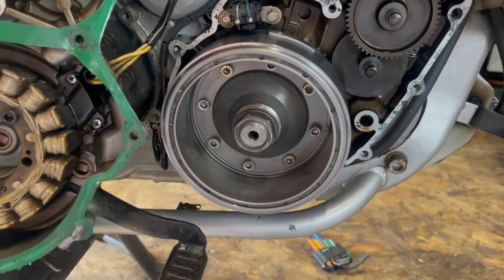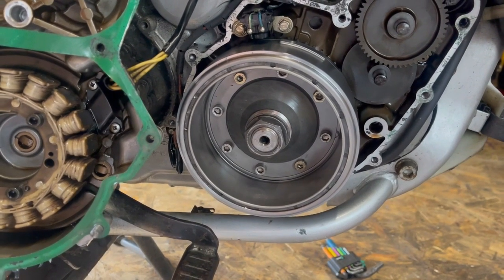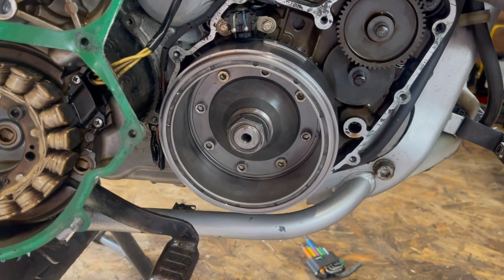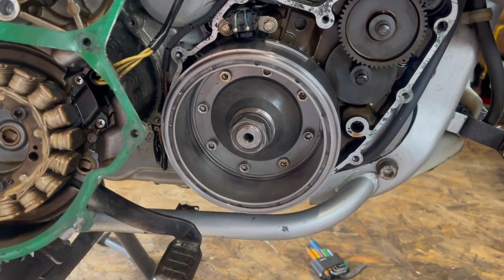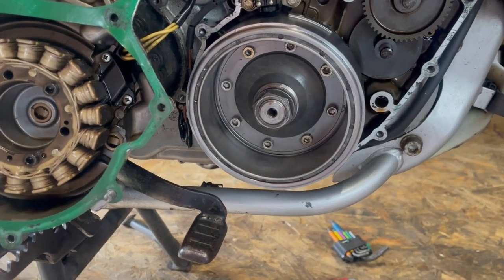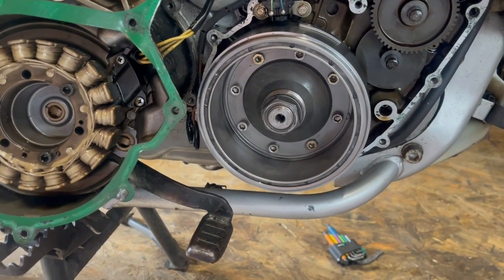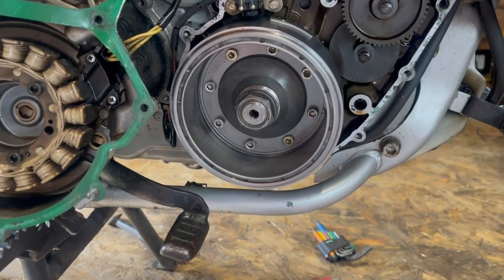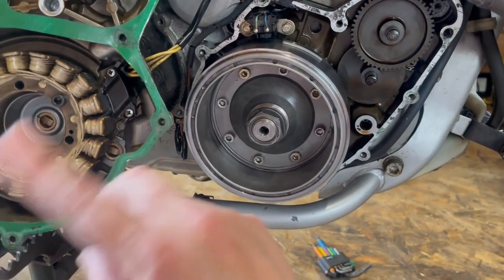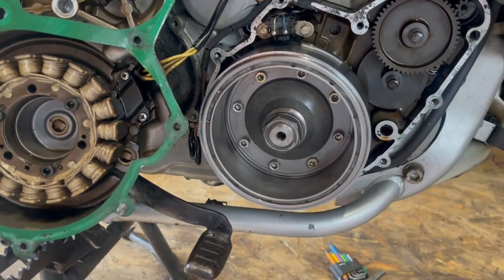So, nut successfully tightened to 180 Newton meters, which is shit yourself torque. It's to the point of this is sketchy, and then click, it went. Crank pin held, so that did the job, which will make the job of future torquing, if it goes again, a reasonably pleasant affair. So anyway, I'm going to leave the Loctite overnight to set, and then bung the cover on. Well, I could bung the cover on now, but yeah, can't be arsed.